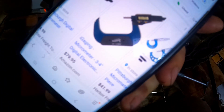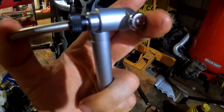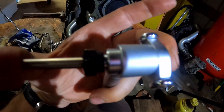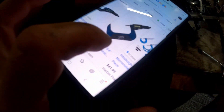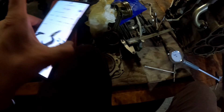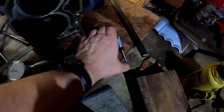Like I said, if you had the digital micrometer — the actual micrometer with the digital gauge on it — it would be much easier. For people wondering what a digital micrometer looks like, it's a micrometer you place on both ends here and here, and that's where it moves. When you have a digital micrometer you can clamp it into something and it's really easy to get the measurement. With the dial bore gauge it was more difficult squeezing that little tip between the arms of the digital caliper, but I got the right measurements and confirmed it: 0.002 of an inch piston-to-cylinder-wall clearance.